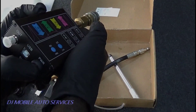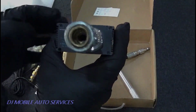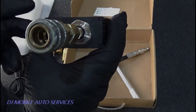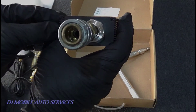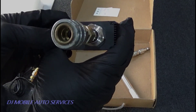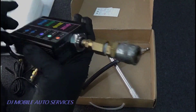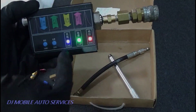You power on like this, and the lights come on. When it's charging, the light is blue. These are the ratings right here — the red range is minus 15 to 500 psi, or about 34.5 bar. You can zero it right here by pressing the zero button.